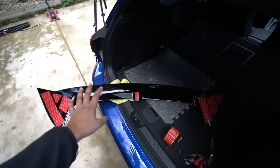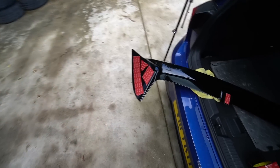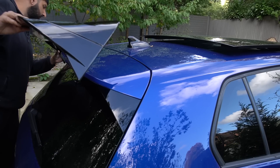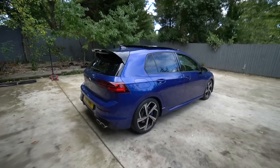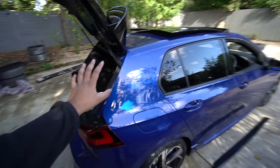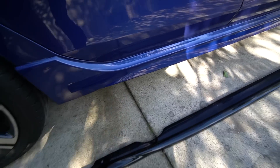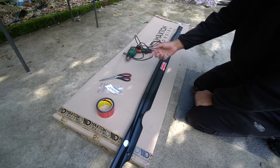There are a few different ways of putting the spoiler on. With the Mark 7 era, people used to just bond them on. I'm going with some 3M tape — I've got the big roll so I can cut it to shape. You don't want to put it completely flush otherwise it will touch the end of the boot lid when it opens, so I've left a little gap. I don't know about you folks but I think that looks way better — the car just seems a bit more like an R now. Moving on to the side skirts, these are relatively easy to install. The part where it curves out matches the OE side skirt profile.